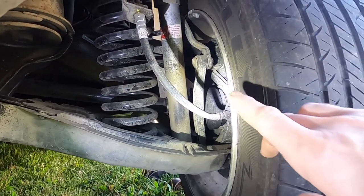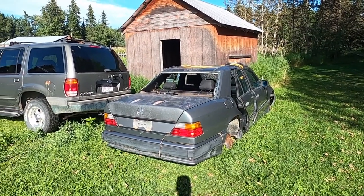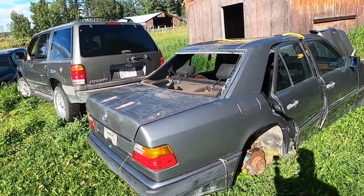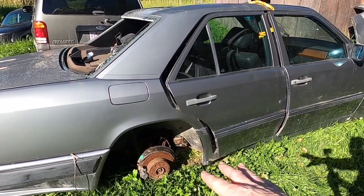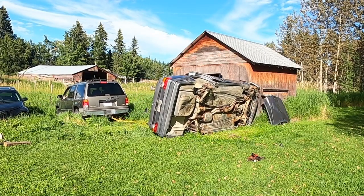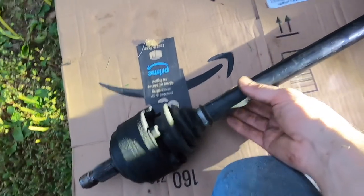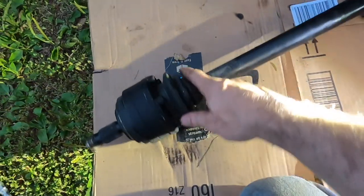I don't know what to say here because I just put two of these axles in brand new. I'm pretty desperate to have the V8 Mercedes back on the road today if possible, so I don't want to wait for a new CV axle — that didn't work out too well last time anyway. So we're just going to go with this used axle from the parts car. It looks rusty, but the boots are intact. I got the axle out, so I've got a used one to go in at least temporarily.